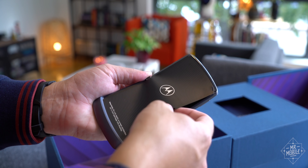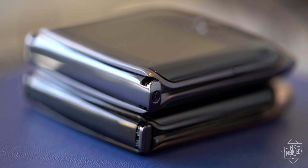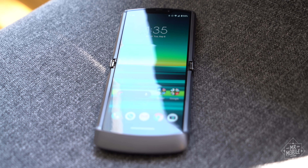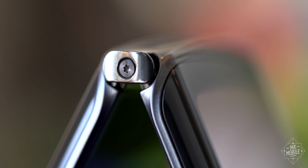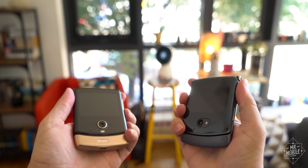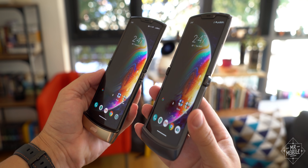Inside, familiar components have been tuned up. It's the same P-OLED display, ensconced teardrop style within a similar stainless steel hinge, but the display is now stretched more tightly across the metal supports underneath, and the hinge now has fewer moving parts. Motorola tells me that's meant to cut down on the potential for the kind of noises that caused such concern on last year's review devices, and at first listen, it is substantially quieter than the Razr 2019 review sample I've carried since March. Motorola says this new hinge should be good for 200,000 flips, or about five years if you flip it 100 times a day.